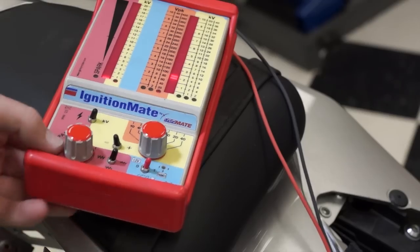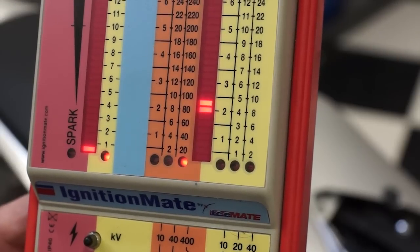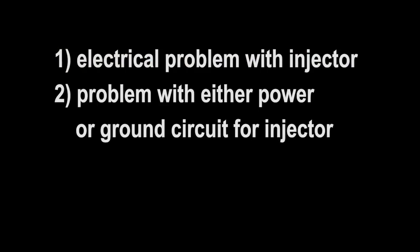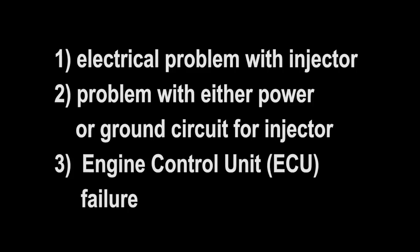You'll want to test all cylinders. If you get the same peak voltage from all of them, we can safely determine that all injectors are operating correctly. But let's say you get 90 volts out of three R6 injectors and only 40 volts out of one. Again three possibilities: either that injector is bad, there's a problem with the wiring, or the ECU has failed. A low reading could be the result of a poor connection or excessive resistance in the injector coil, causing a weak magnetic field that would not induce as high a voltage when it closes.